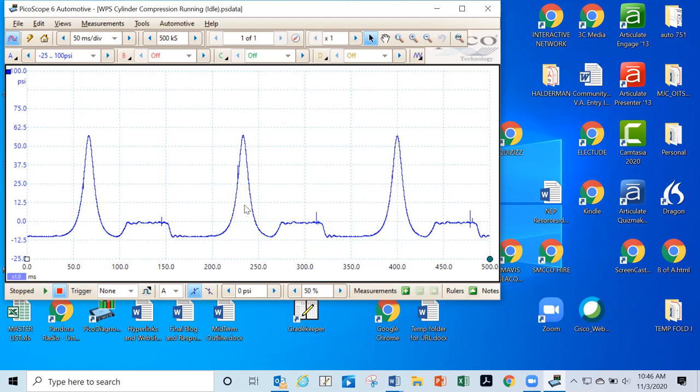Okay. And the other thing you got to remember is the individual cycles. Since this is the pressure cycle, this first section here is going to be the power. We usually say intake, compression, power and exhaust, right? But in this language, if we're going to start here, then we got to say power. This is where it's going to come down: power, exhaust, intake, compression. One more time. Power, because we're pushing down. This is where the compression cycle is, but let's start here and say this is power.